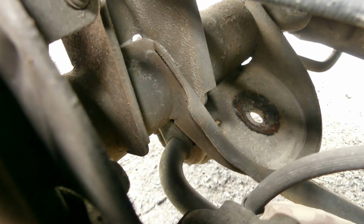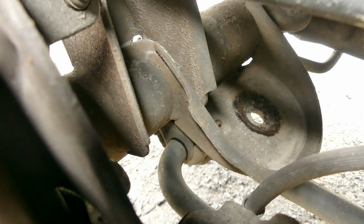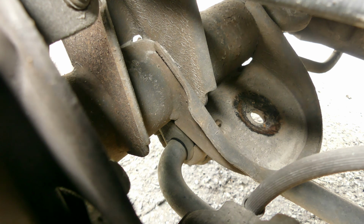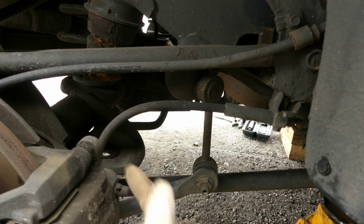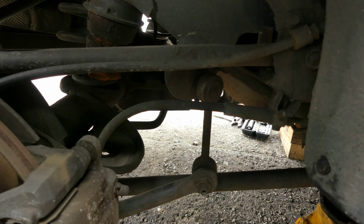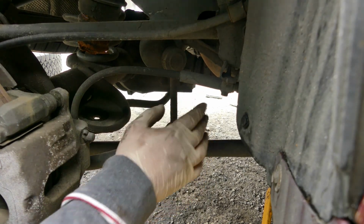But again, we're not gonna replace everything. So that's one more plate right there. I don't know if the customer is gonna replace this too, because he also asked me to replace the brake. But anyway, for the meantime, let's replace the driver side rear stabilizer link bar. Let's leave this, but at least we can show it to him. Because this one is not yet connected there, we already removed the stabilizer link bar on the driver's side. Maybe that's why it has a play. Anyway, let's go into the store and replace the other side.